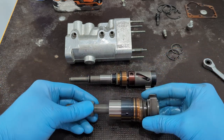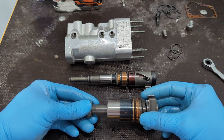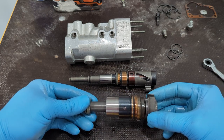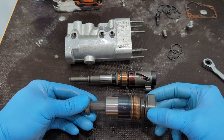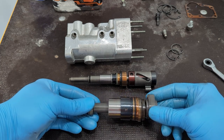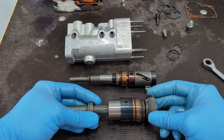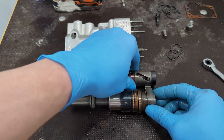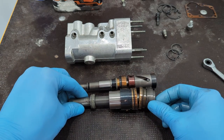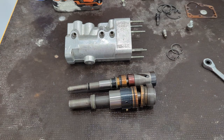Then this guy, as it moves up and down, this assembly is what cams out right here. As it moves in and out, it cams out and the rotation entered from that will then select your actual gear — first gear, it actually engages the gear. So this whole assembly kind of sits together like so, and that is how it rotates. This is pretty much how the entire assembly works.